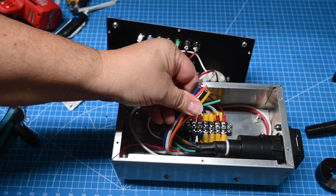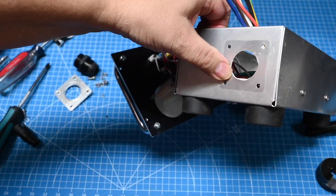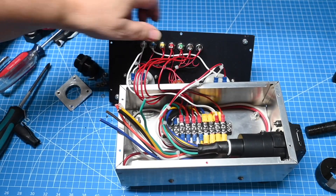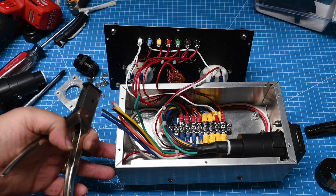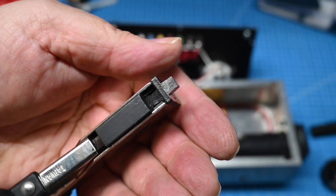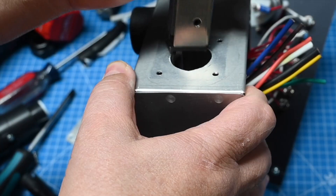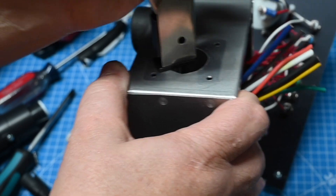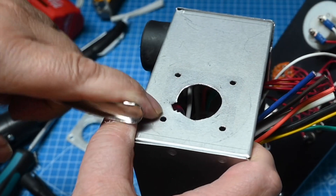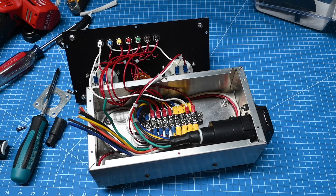Now that we have our wire separated, we can enlarge this hole to fit a seven pin connector. How do you make the hole? I can't use a hole saw because I've already cut a hole. I could use a nibbling tool — each time you close it, it just takes a nibble of the metal out, cutting a little notch each time you depress it.